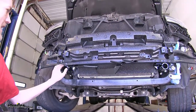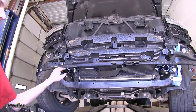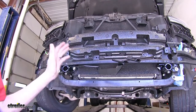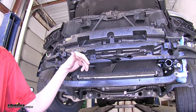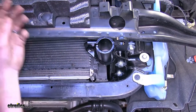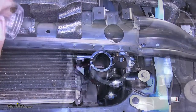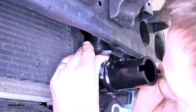We've gone ahead and put on our passenger side base plate — it is the exact same process as the driver's side. Now, if you're not going to be installing any wiring or braking system, you don't need to worry about attaching this center beam. However, if you do plan on using any wiring or braking system, we'll show you how to install this on the driver's side — it's the same as on the passenger. Regardless, we need to drill a half inch diameter hole through our bumper beam at the inner location. We'll drill a pilot hole first and then enlarge it to the appropriate size.